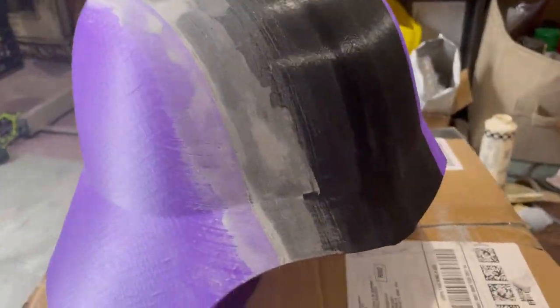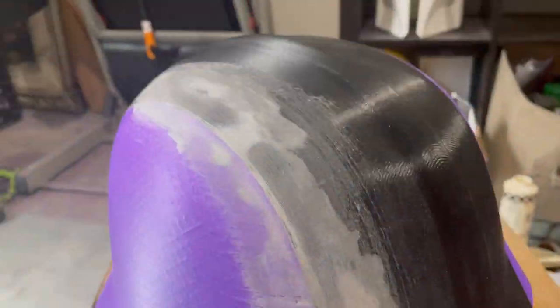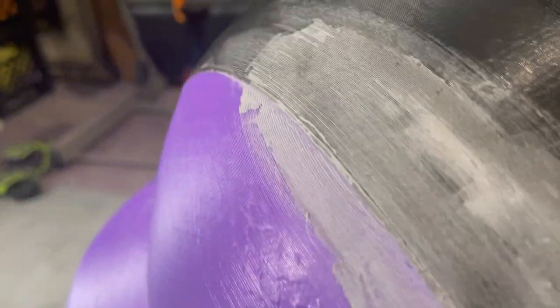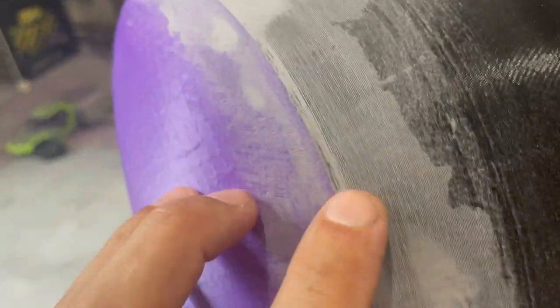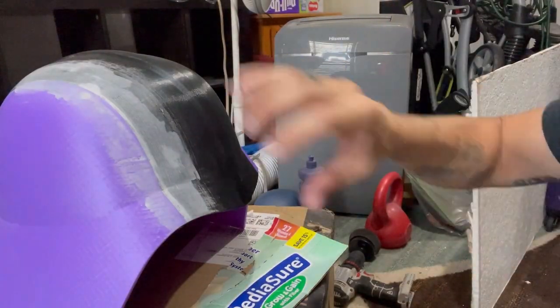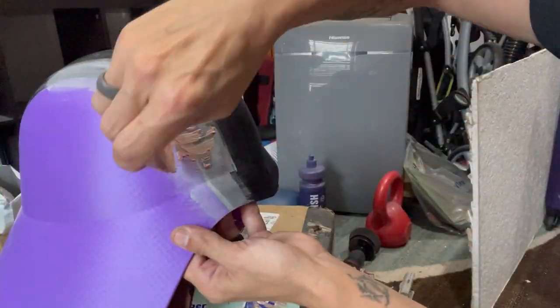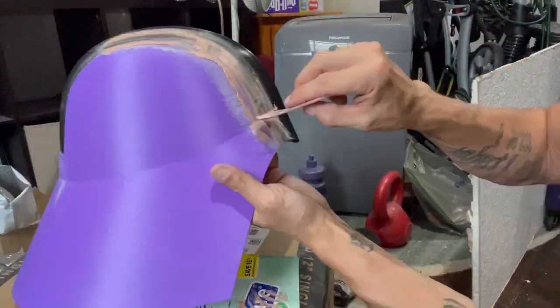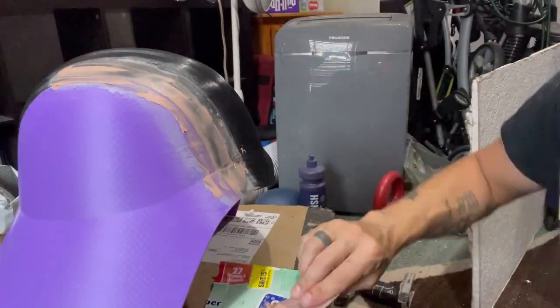In those videos, I specifically touch on how to fill in those weld marks, but the process doesn't change. So after the dome was all filled in and prepped, I did a sand with basically 160 or 180, whichever you want to start with, and then 220. You can use a machine, and you'll see in the video that I do use a machine for the glazing putty. However, you want to use a nice little interface pad, something soft and spongy in between, and you want to definitely use a lighter grit.